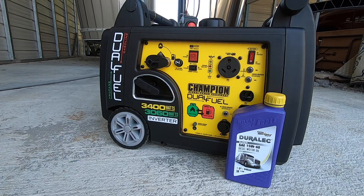You might ask why I'm not using 10W30 as recommended. Well, I'll primarily be using the generator in warmer climates, and 15W40 I think will be sufficient. This is the same oil I use on all my small engines — two other generators, two tractors, a golf cart — and it's also the oil I use in my Ram 3500 with a Cummins diesel. So when I travel, I won't have to carry more than one type of oil.